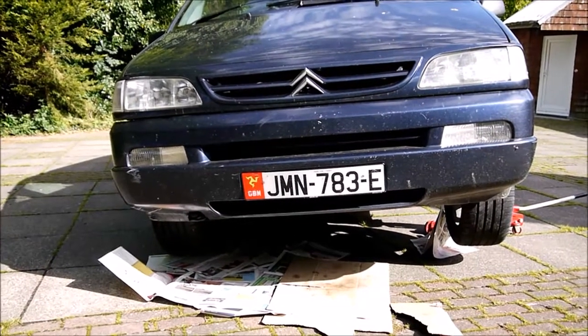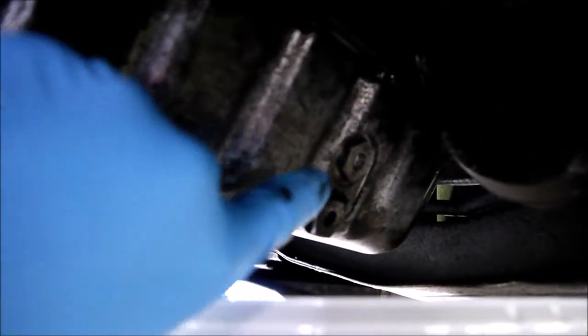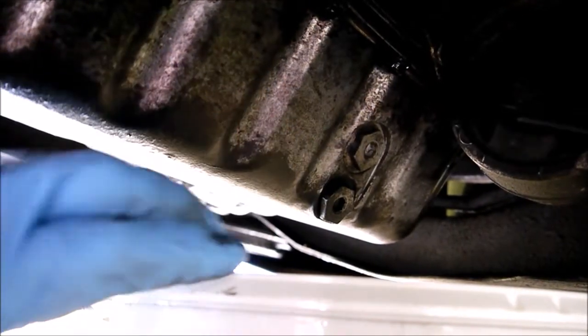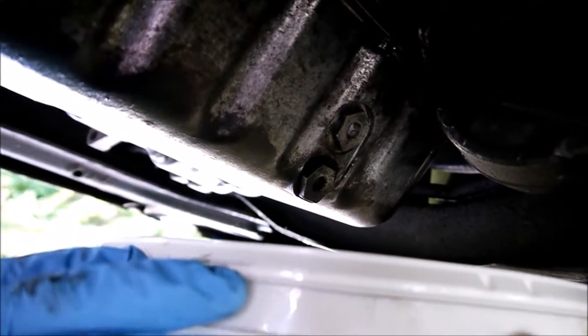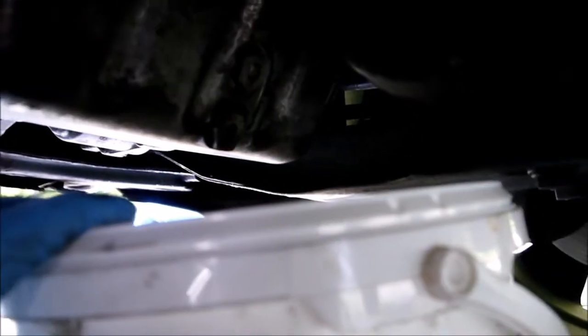By jacking the vehicle up it gives you extra room to manoeuvre underneath if you don't have the luxury of a pit or a ramp. We are now under the vehicle and we can see the sump plugs here. There are actually two sump plugs on this vehicle — one might be for an oil temperature probe that was never fitted. We're going to remove the lower sump plug on the bottom of the engine. Sump plugs are sometimes on the back of the engine facing the rear of the car, sometimes actually on the bottom of the oil pan — you'll find them around. We want to be careful not to mistake the engine oil drain plug for the gearbox oil drain plug over here — make sure you've definitely identified the engine oil drain plug.